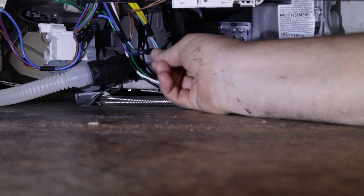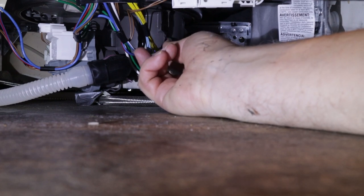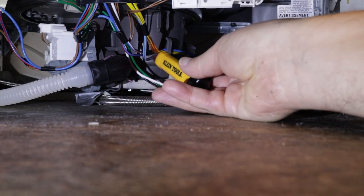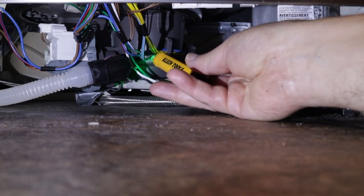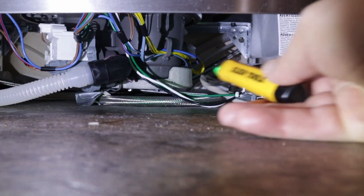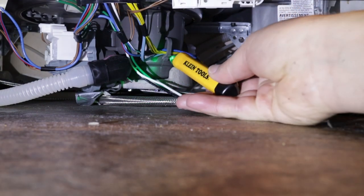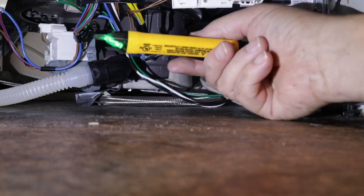Alright, so that is the turquoise wire — we'll give that a check. I checked it earlier and there was nothing. Now we'll give it a push and start button to resume. As soon as I close the door — there it goes. That's it. I'm going to replace the pump.